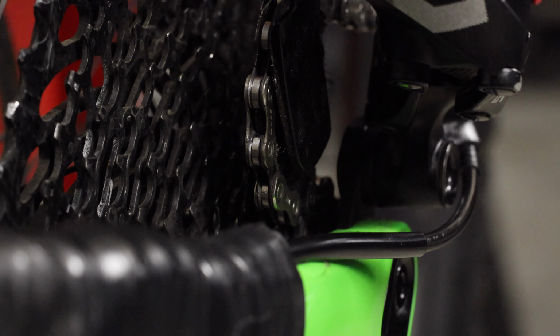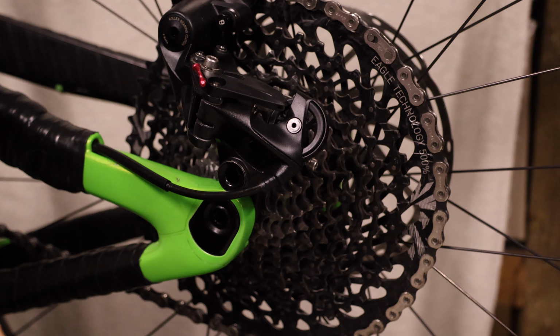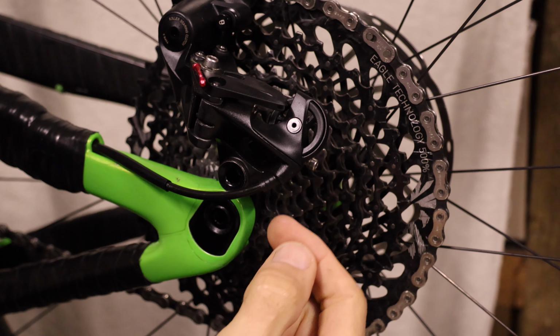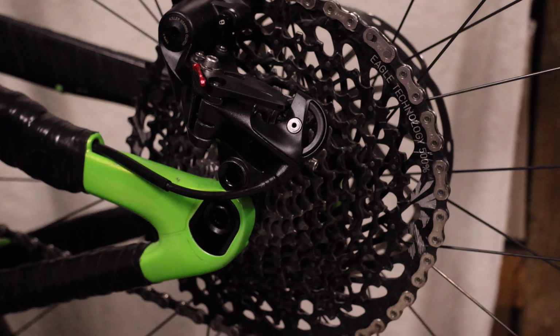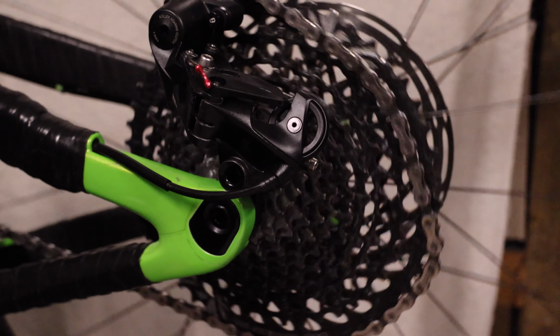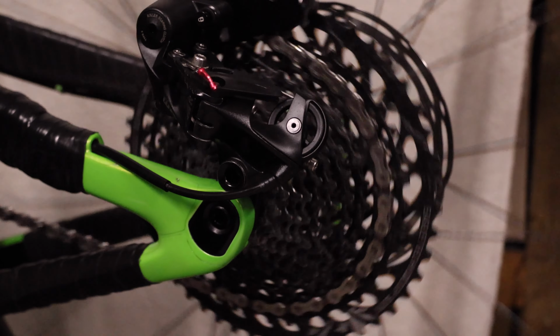So there's the derailleur setup, the adjustments, the end stop adjustments, the B-screw adjustment, which is highly critical. Once you've got all those main adjustments done, your outer and inner limits, your cable is adjusted, you've taken up the slack and you've adjusted it so that it's changing from 12th to 11th gear and backwards, and it's sitting the jockey wheel exactly above each of those gears, then you've got everything set up just right, and you should have gear selection correcting on every gear just nicely.